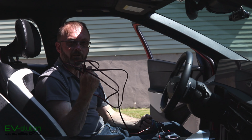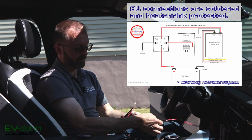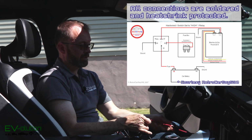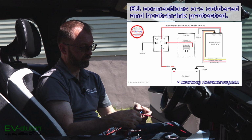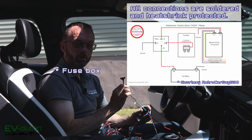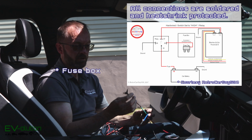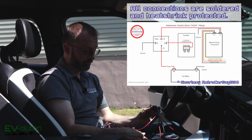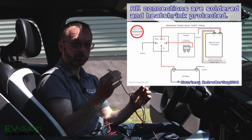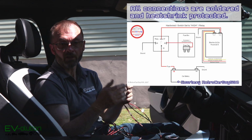So I've got the power wire that goes to the Powercell 8, and it's hooked up to this relay. And the other wire that's going from the battery comes through the firewall, through a factory grommet, into a fuse, and then gets taken care of by this other stuff. This fuse tap will plug into an accessory port, the USB charging ports that I had used previously for the other hardwire kit. And then you've got a ground and another ground. The ground for the relay and the ground for the Powercell 8. And both of these will be connected in the same place under the dash, exactly where I had grounded my previous kit.